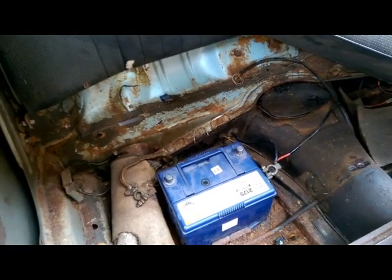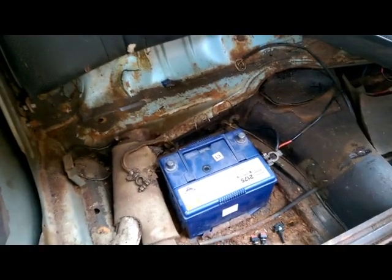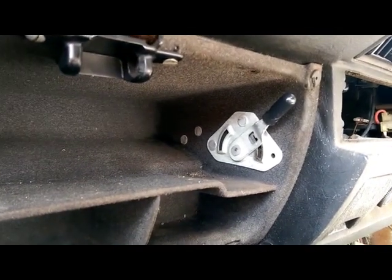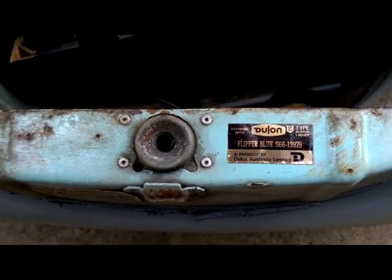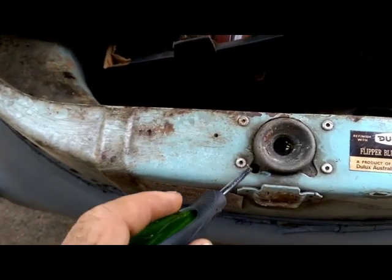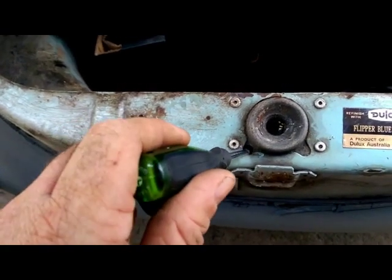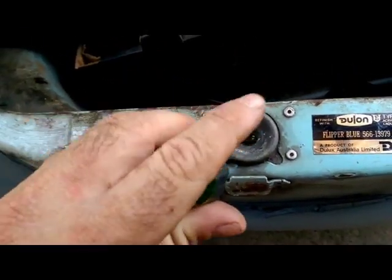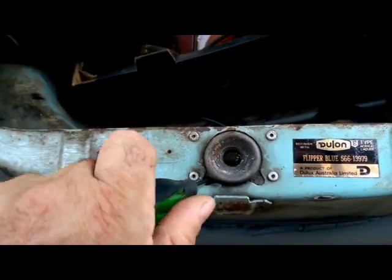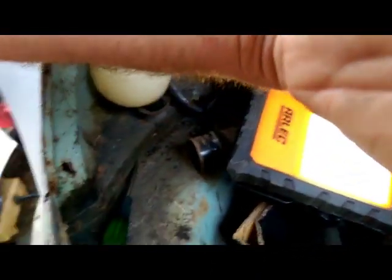When you're going to be working on electrical stuff, obviously it's a good idea to disconnect the battery first. The bonnet release cable actually can't be disconnected at this end — it needs to be disconnected at the latch end. The release cable is very easy to disconnect from the latch. This hole here has a Phillips head screw down inside — that's on a right-hand drive car; a left-hand drive car would have it on the other side. It doesn't need to be undone completely, just a couple of turns to release the cable. I should be able to show you better from the underside — there we are — so by grabbing the cable, that should pull out of the latch like so.